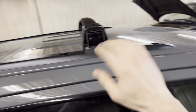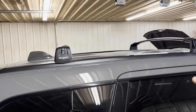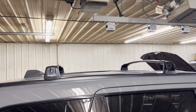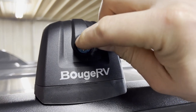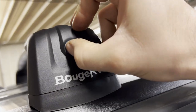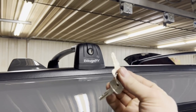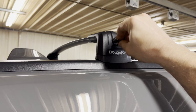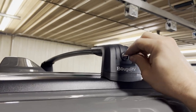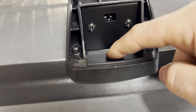On the front, the second bolt is right there where the front crossbar is mounted. On the rear, the second bolt is right underneath. This is the recommended position, though you can adjust if needed. If there's shipping plastic or blue adhesive on the locks, peel that off. Then grab your key and insert it at each end cap — four total — rotate counterclockwise a quarter turn to lift each piece off.